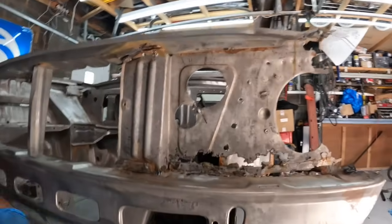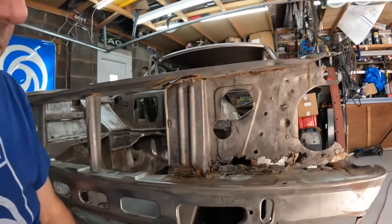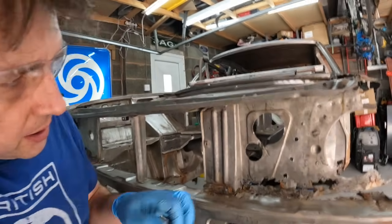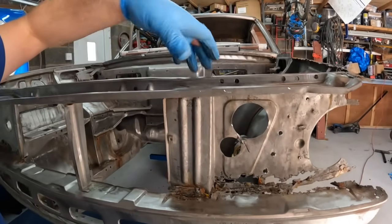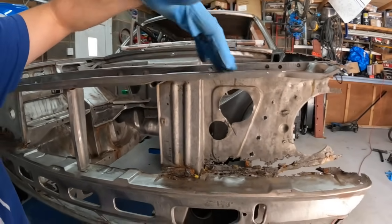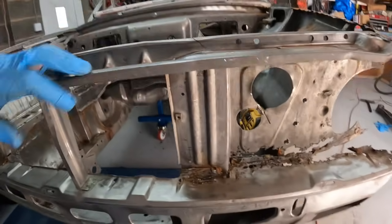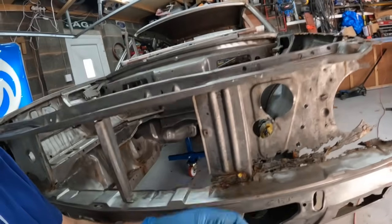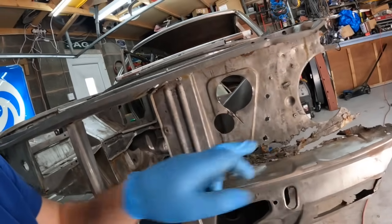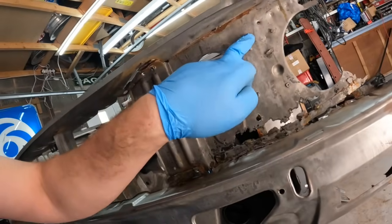Common practice I suppose - somebody asked a garage to do a job that probably should have been taken to a body shop. What I've done here is basically drilled out the spot welds of the original panel where it was welded to this slam panel. This slam panel could be repaired - it's just a bit of a slice taken out. I had to use the cutter because it had gas welds that I obviously can't drill out, so I've cut those out. There are a couple more spot weld drill holes to do on there.